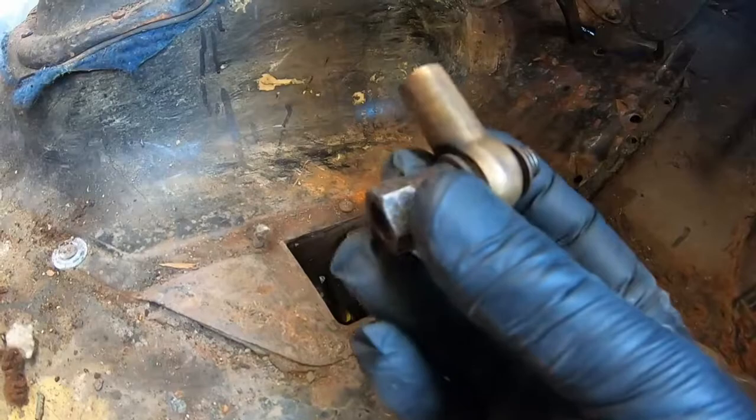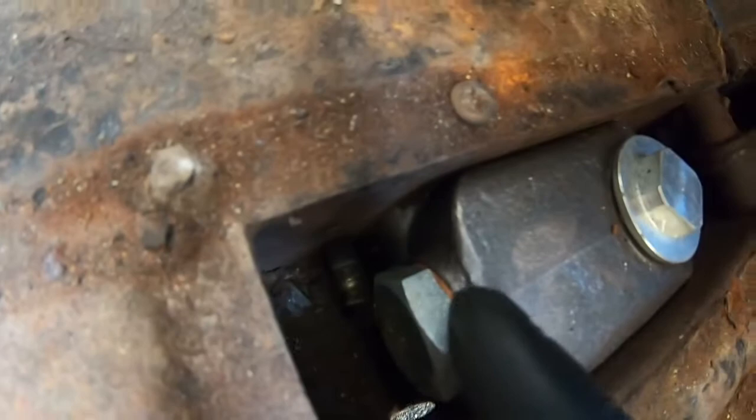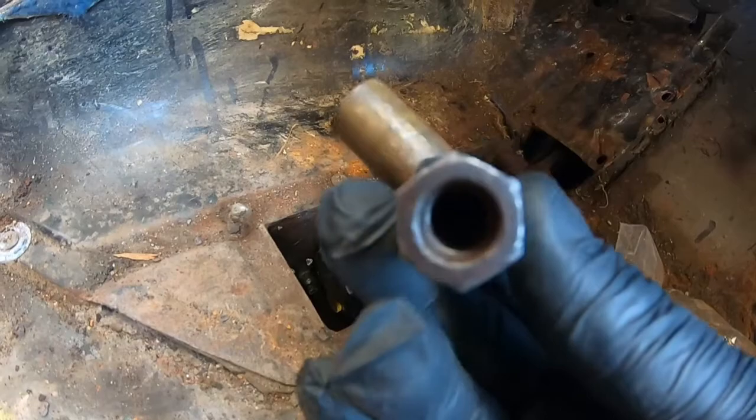But it's here. Now, let's see if I can get you under the car to show you. There we are, you can see the brake hose there. I'll try and highlight it in the video. That's where it's going to. And I'm not entirely sure, but I think it goes up in that hole there and comes through the chassis leg to come out here into this banjo bolt and union. So this banjo bolt here, if you look in the hole, there's my front brake pipe there. So that goes in there like that, and then the rear one goes in there.